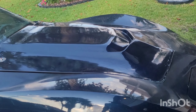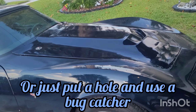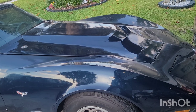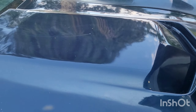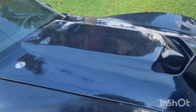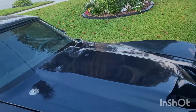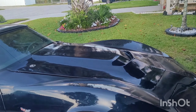Can't get the engine to sit any lower. So here's the question: do I replace this hood or the hood scoop — the cowl, or however you want to call it — I think it's the L88 style? Do I replace this, modify it, or go bug catcher and just notch it out right up ahead and center where I need it to come through and just leave the bug catcher sticking out the top? It's not going to be a blower — it's just going to be the bug catcher.